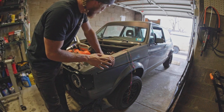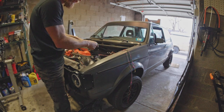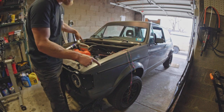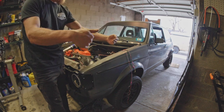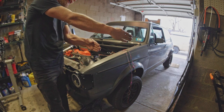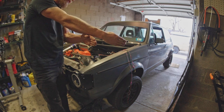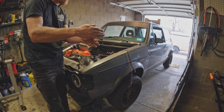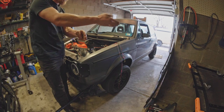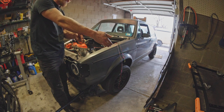The other reason this works out well is that the tightest constraint of all is the CV axle and the frame. Your control arm is coming in and your CV axle is kind of coming across it — if you lift it too high, you're going to end up hitting the CV axle on your control arm. For now I'm going to stick to the two inch, which gets it really close, and at full sag it still might hit. So this is a bit dicey.